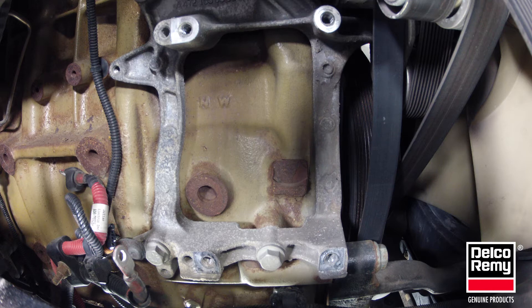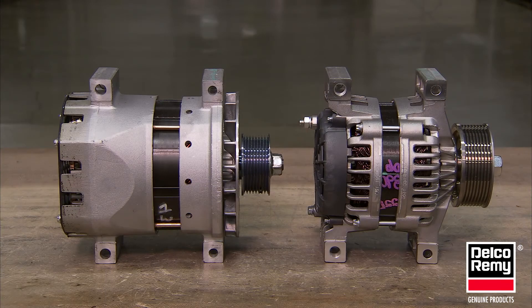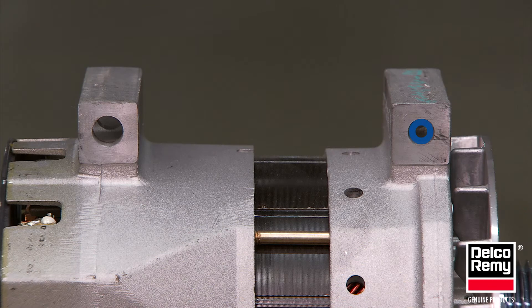The pair of back holes will allow for either a short or long pad mount alternator. Now let's discuss why we have two alternator mounting hole sizes. First, the small mounting holes in the drive end are intended to be tight to the mounting bolt. This ensures proper pulley alignment, which is essential for belt life and system reliability.